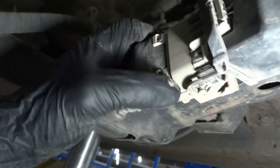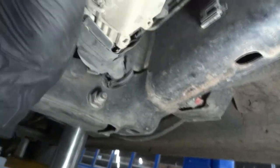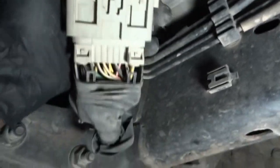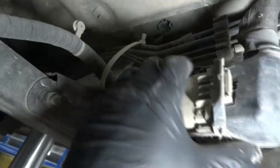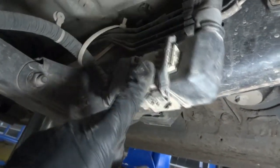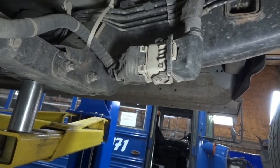I'm going to disconnect this electrical connector. We're going to see inside to see if it looks dirty — if it does, we're going to clean it. Our wire is a yellow and red. Let me see if I can find that wire over here. I'm suspecting our problem to be in this connector. Hopefully it's just in this connector, because that's going to be pretty easy.